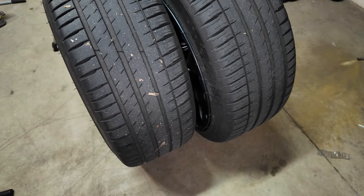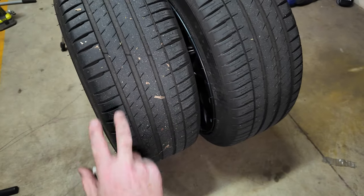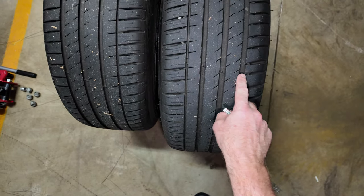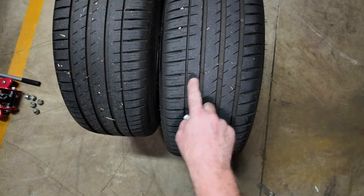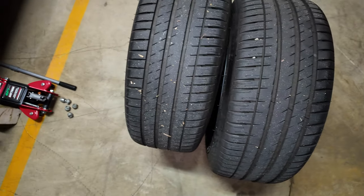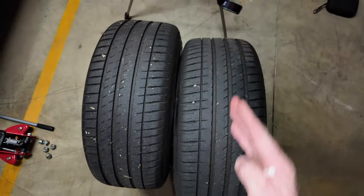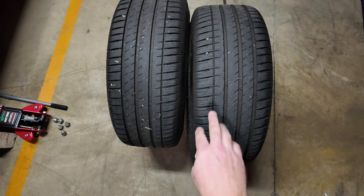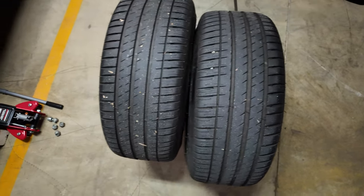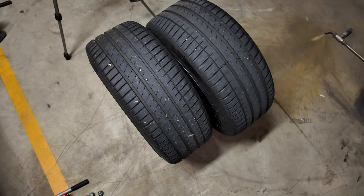With these tires I'm hoping to get 40 or 50,000 kilometers out of them. Looking at them now after 10,000 kilometers, my first impression is they look quite good — I'm not seeing unusual tire wear, no excessive wear in the middle, no excessive wear at the edges. You look at the outside and inside edge for wheel alignment issues. If the wheels aren't aligned, your front tires end up doing a snow-plowing effect and you get uneven wear on the outer tread edges.